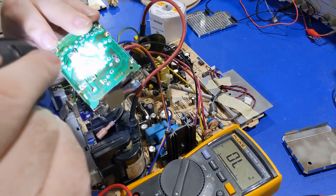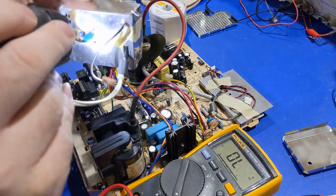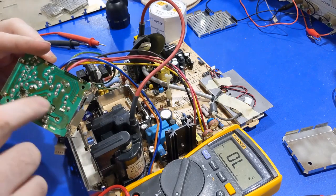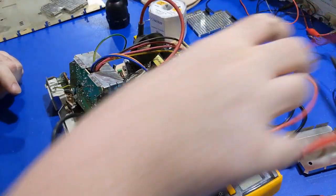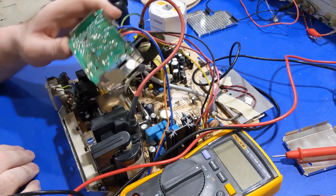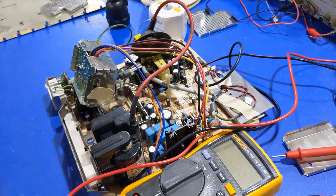That resistor is cooked. What does that go to? It goes right into the CRT socket. That resistor is coming up through around the corner — it's going to this CRT pin. I wonder if the CRT is shorted. On the other side of this resistor there's an orange wire — that orange wire comes out and goes right into the flyback. That's the filament — it heats the filament. There's a dropping resistor for the filament in there. I think what I'm going to do now — I've got a course of action. I'm going to take care of all the solder joints, check that resistor, re-solder this board here, and then try it out. I think we'll be okay.